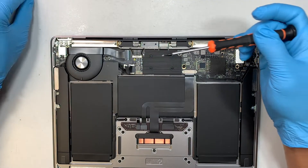Make sure the cable is on top of the laptop — meaning it goes above it. You do not want it at the bottom or you won't have a display. Lift it up and place it on top of the computer. The next step is to slide the hinge back down on both sides. Make sure the cable is still above the laptop, and now you can see the hinge is installed on both sides.